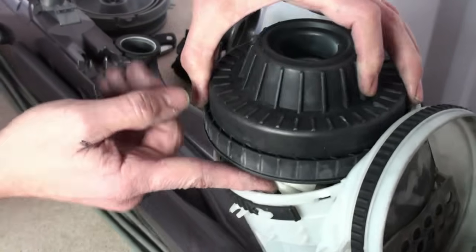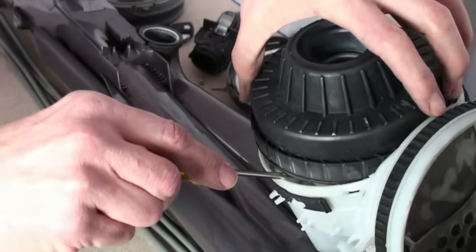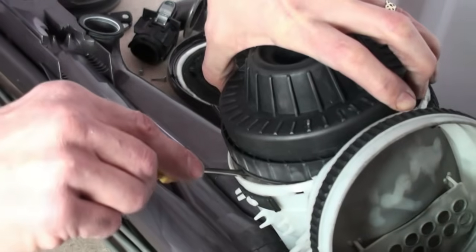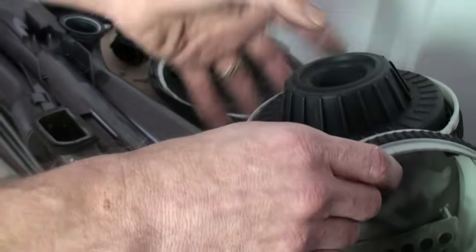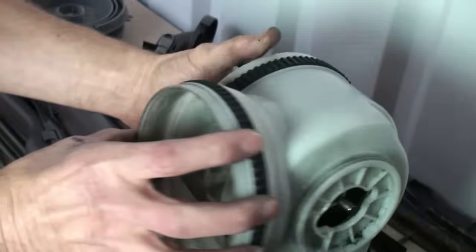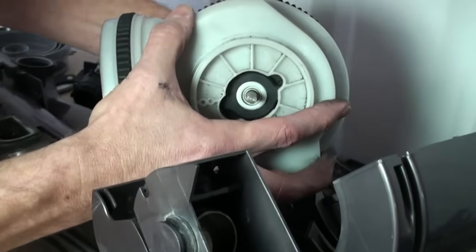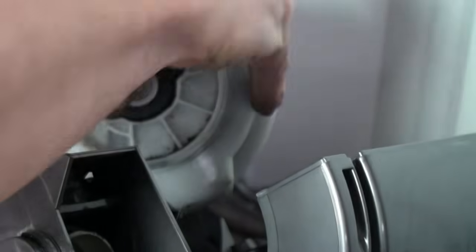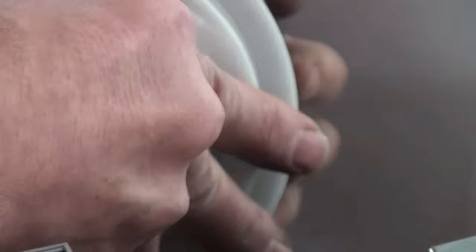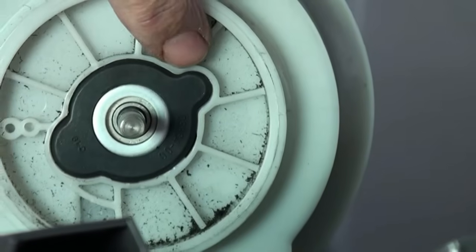And it's important when fitting the motor into the housing that the wiring is placed above the motor brush. This ensures that the motor seats flush when it's in the motor housing. If the wiring isn't above the motor brushes, then the motor won't fit into the motor housing far enough.